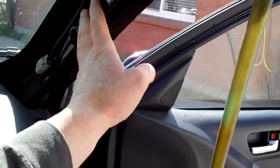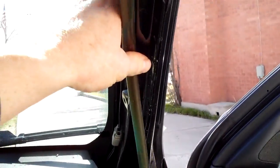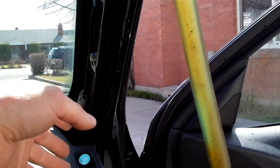And it goes down inside of the A pillar. Got A pillar, B pillar, C pillar, and D pillar clear back there. So it's just alphabetical. This is the first one, so it's A. So anyway, this little tube goes down inside of there. If there's an accident where the A pillar gets hit or a windshield gets put in, something happens with it, or somebody cuts it with a knife when they're cutting the windshield out, it'll make this hose leak, and you can have leaks in here.